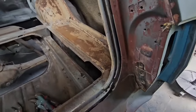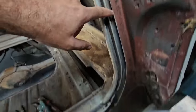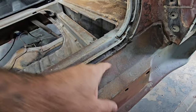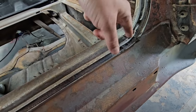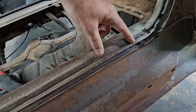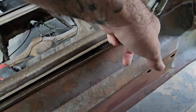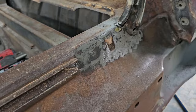What I'm doing at the moment is getting this inner channel for the rubber - it runs through here. I'm going to cut that one out and put another bit of metal straight through here. I'll trim out from here to here, and depending on if I can tack weld those I'll be happy, or I might just cut it and bend a piece of metal in. It all depends on how bad the rust is behind here once I pick it all out.